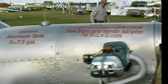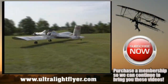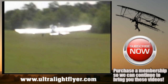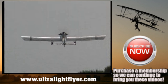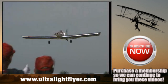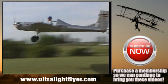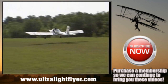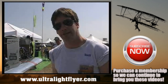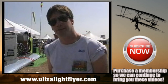What kind of performance would the average person get out of it — take-off distance? We've got the big engine on here. The only limiting factor from making it a true ultralight is the top speed. Take-off distance is about 150 feet. Landing distance about 300 feet. Cruise with the smaller 28-horse engine — that would be a legal ultralight — at 63 mph. Stall speed is 25 mph. Fuel burn at cruise is about 1.8 gallons an hour.